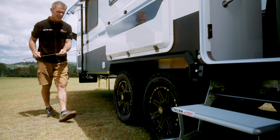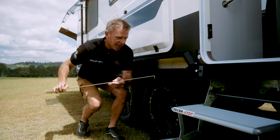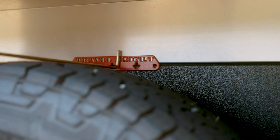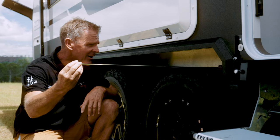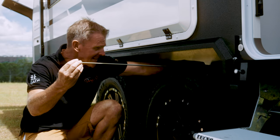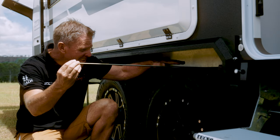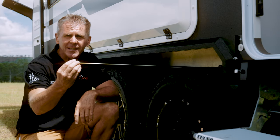Your awning bracket — or any straight edge — will do the job, but the awning bracket works really well. It allows you to put it across the flat of the tire and then line it up with the red telltale plate in the wheel box. By doing that, it confirms you are at the correct travel height and ready to go.